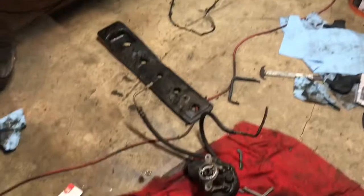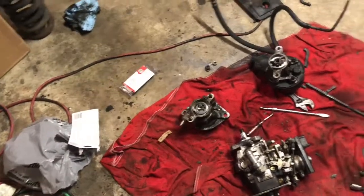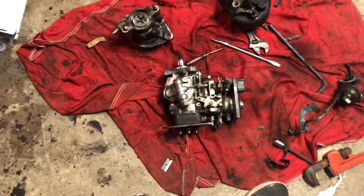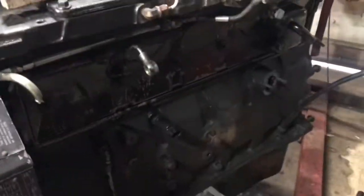Hey, what's up guys, we are out in the garage and we're hopefully gonna get a decent amount of work done today if the temperature doesn't drop a bunch. Let me show you what we got done yesterday — we got the pump off, that's the power steering pump to the right and the vacuum pump to the left. We separated them. I'm gonna replace the gasket between those two and clean those up. I got a brass-tipped fuel shutoff solenoid for the pump that I gotta put in.